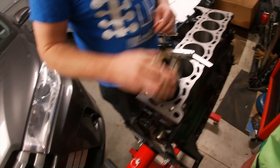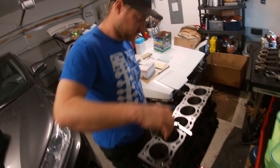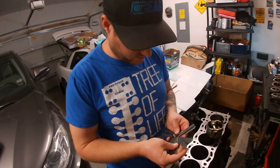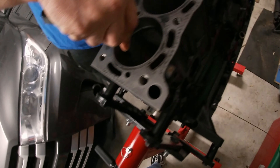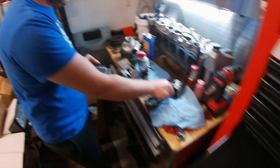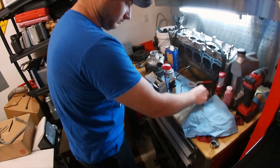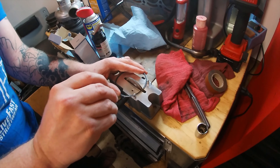But the second rings were out of spec. So did you get new rings? No — after some research, found out that the rings were okay, but I should be going bigger than factory. Bigger than factory, because of that boost from that big old turbo. We got to grind. So we've got this spiffy little ring grinder. We're going to file this ring with this spiffy ring filer — this precision machining tool.